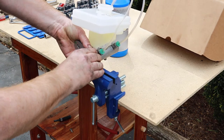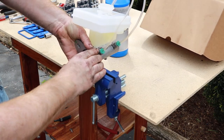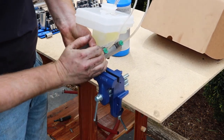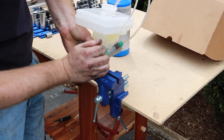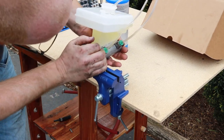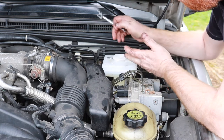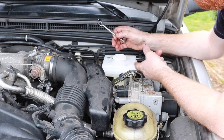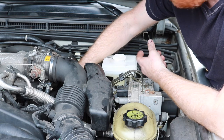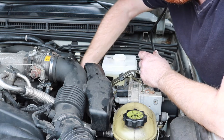You're going to pump it — it's the same as pumping your brake pedal. It's got two pockets in there and one can empty out before the other one does. I pumped it a bunch of times and now I'm going to put it back on. I made sure the seal was on there — it's just hand tight right now. I did some practice pumps inside the car with the brake pedal just with it being hand tight to make sure it was working. I could see that it was actually moving some brake fluid, so that's good.